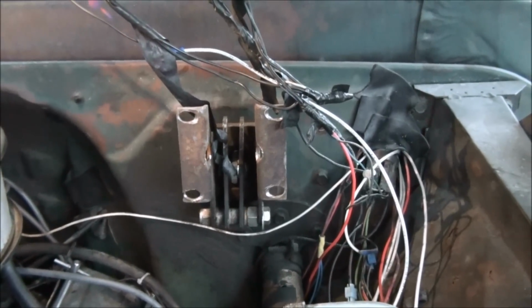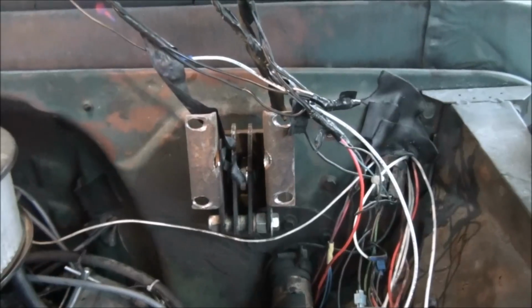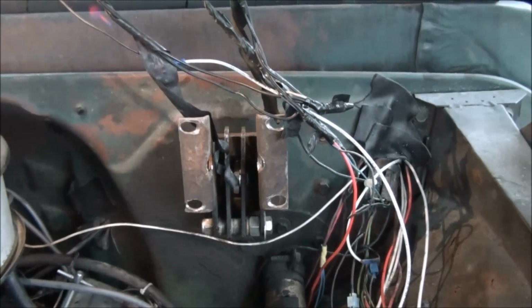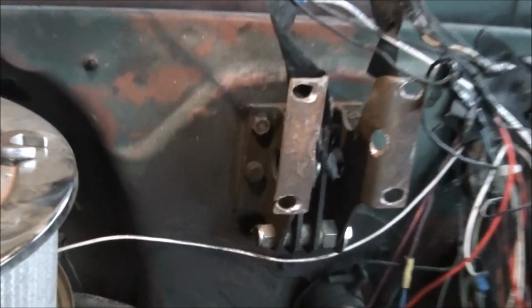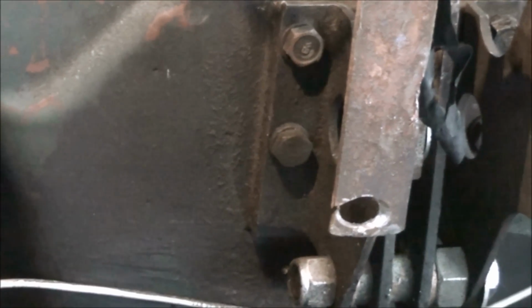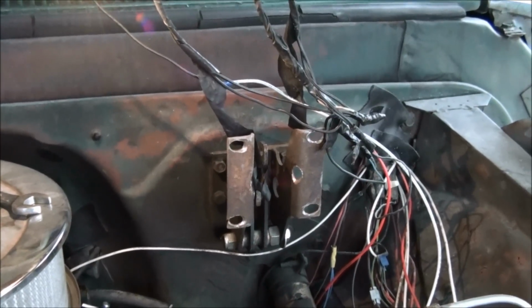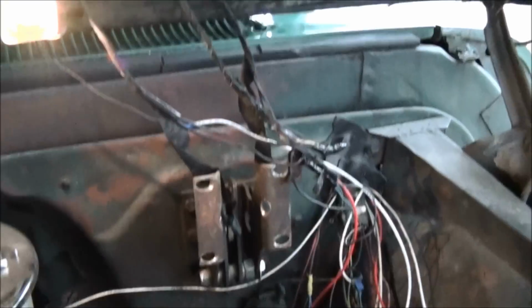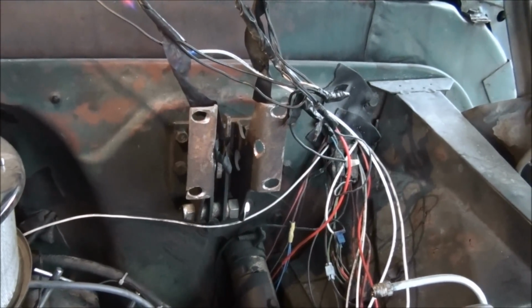Yes, it will work. I've done it. You can take a Ford truck bracket, pedal rod, the whole nine, and put it in one of these old trucks. The only thing you do have to do is back here where it does bolt on, it's a little different. If I remember right, you have to drill 2 new holes in the bracket, but it will fit. And if you get the correct booster, if I ain't mistaken, it's an F-150 is the one that will fit, will clear the hood. The 250 won't, but the bracket's the same. All you really need is a bracket.